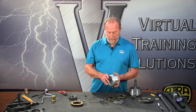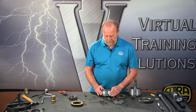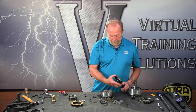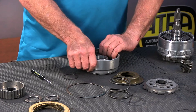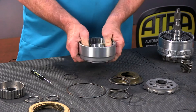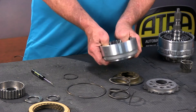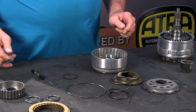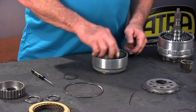We've got all our parts cleaned up, and we're going to go ahead and assemble the drum. Honestly, this is as straightforward as clutch drums get. In with the piston — the thing about these molded pistons is they go in without needing a seal protector; they go in nice and easy. Always use the new pistons. In with the spring, then the retainer. Then the snap ring — over to the foot press. We'll be back in a sec.